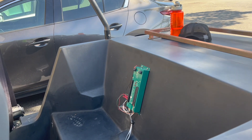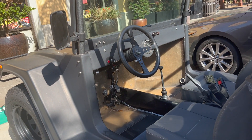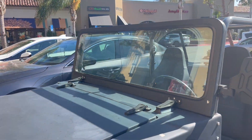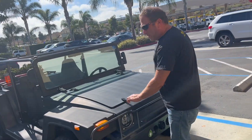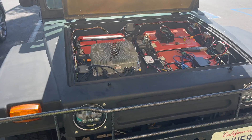What comes off that control board runs up to the front. For this car, it doesn't have power windows, power brakes, power anything — it doesn't need other pumps and things. It's very simple, so a lot of the stuff on that controller doesn't even get used. I've got it limited to 400 amps maximum right now so I don't kill these batteries.